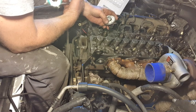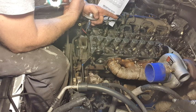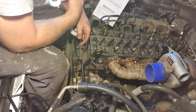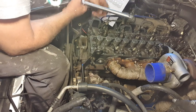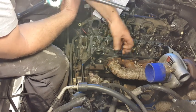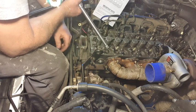And even just getting to 90 and then seeing the mark facing the front of the engine like that, and now I'm just scanning down all the head bolts are all facing forward. I couldn't have done that if there wasn't a mark on them, so I'd highly recommend that. That's probably what everyone does anyway, so I haven't invented anything, like usual. Well, in my mind, getting the head torqued down was just such an overwhelming task, so I'm just rapt to have that done.